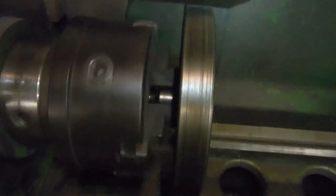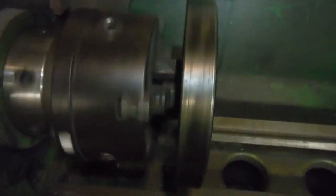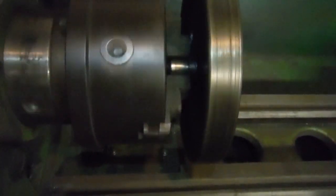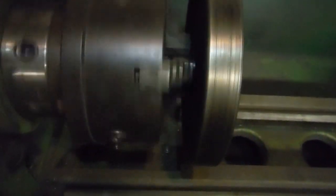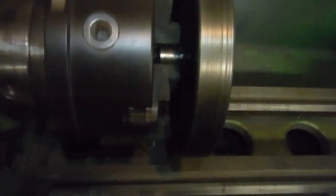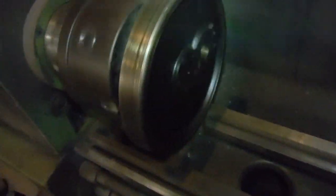The flywheel is running true to the main shaft, so I'm very happy with that — we've got it all lined up and centred nicely. After cleaning the components thoroughly, I'm going to put a liquid bearing compound in there just to take up any slight wear that will have occurred, perhaps in the flywheel boss or on the main shaft itself, and that will lock it in place. With that done, this flywheel will be good to go again.